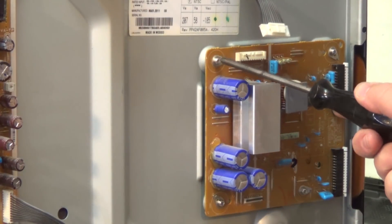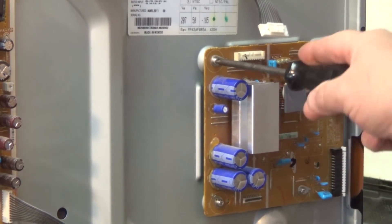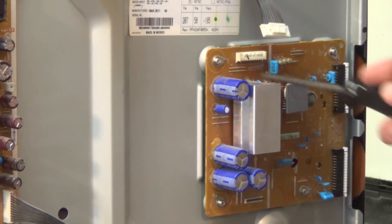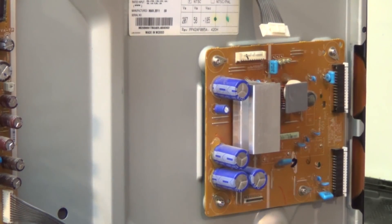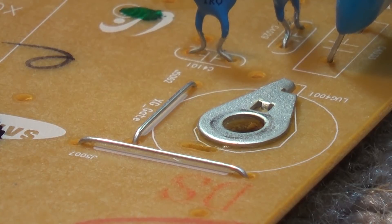Next I'll remove the board, and upon inserting the screwdriver I noticed that the screws were loose. This is a clue, because generally these are grounding tabs that ground the board. If a screw comes loose it could cause a power surge and damage components on the board. So I'm going to remove the board so I can test for failed components — and there's the evidence: notice the burn mark where the screw was seated. The screw came loose.